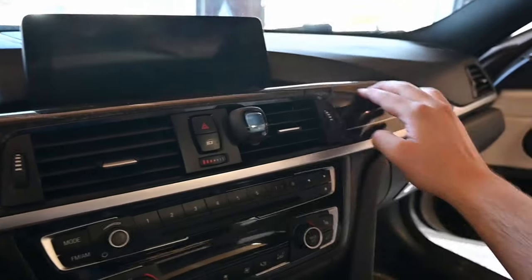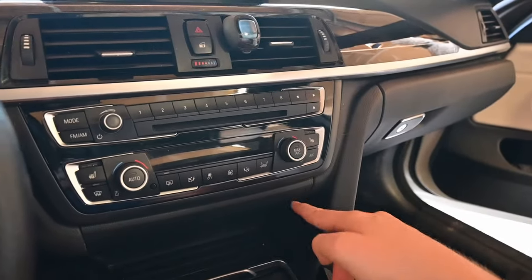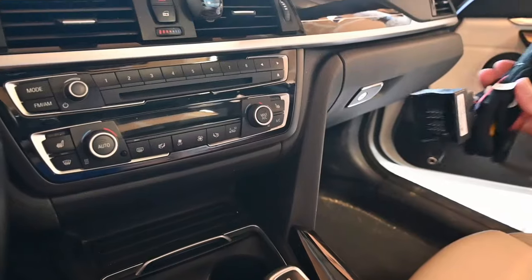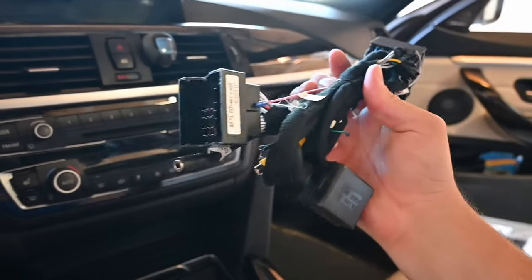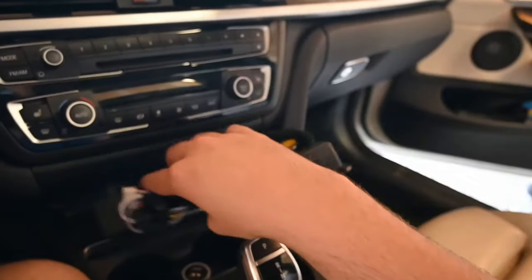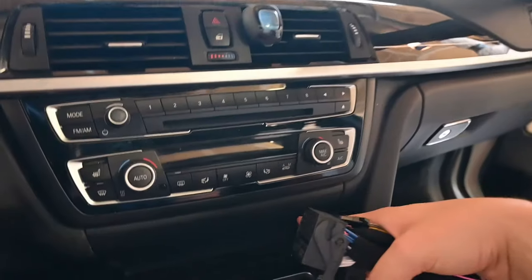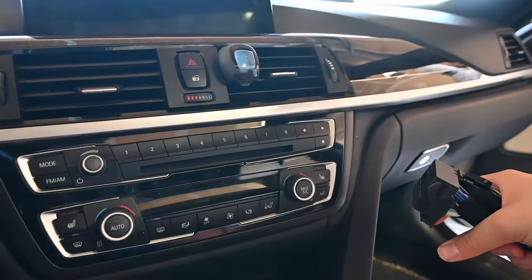Here we are in the car. The first thing we're going to have to do is take off the entire vent and the entire trim, then unscrew — so we're going to take this whole vent piece out; it goes all the way to the end and there are going to be four screws. We'll undo all of those, take out the cover, take out the head unit. Once the head unit is out there's a pass-through type cable to install, and we'll stuff all those cables down in there. This time we won't have the MMI box taking up space, so that should be a bit easier.